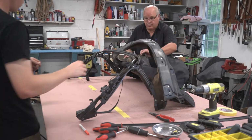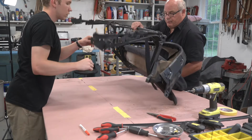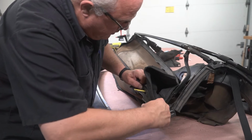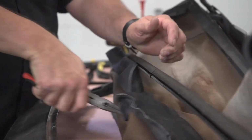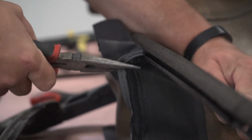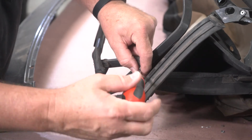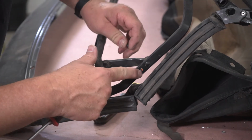The last step was to remove the fabric from the center bow retainer. We used a putty knife scraping tool to open the retainer. Once we got one end of the top fabric free, we pulled it out inch by inch to remove the convertible top. Finally, we had one last retainer screw on each side to remove, and at last the convertible top was free from the frame.